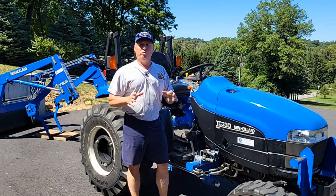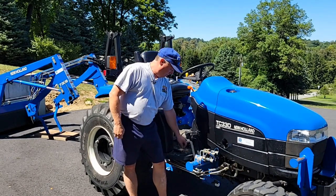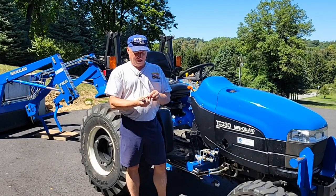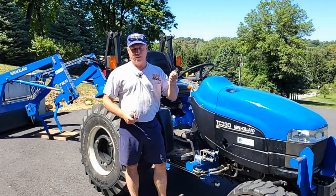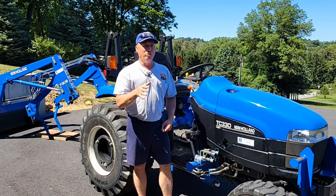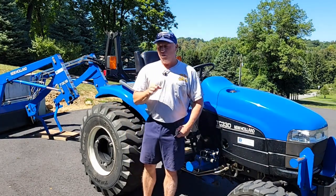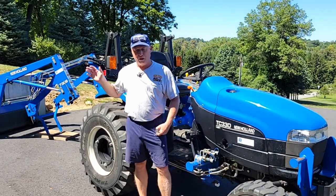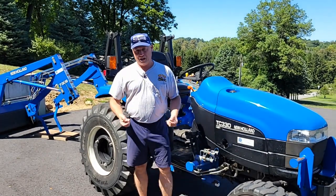It's bad. The only tools you're going to need for this project are a 1 1/4 inch socket, a Phillips screwdriver, a 7/16 inch socket, and last but not least, a 1/2 inch socket with about a 2 inch driver, plus the ratchet. So let's get started, and I'm going to show you how to change the ignition switch out of a compact tractor. One note, I was able to get the loader off. It's not necessary to get your loader off if you do have it on the tractor during this repair, but it will make the repair a lot easier.